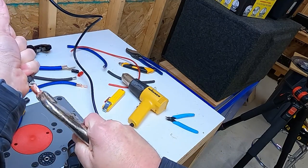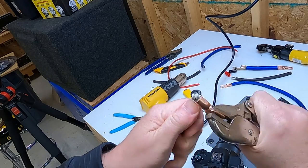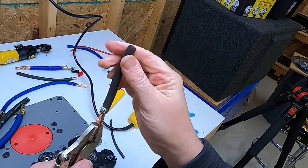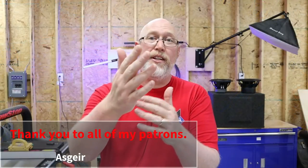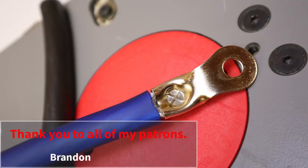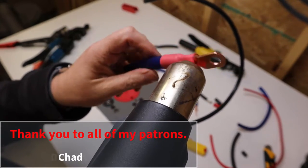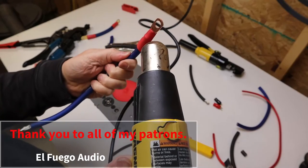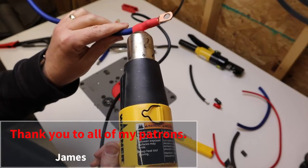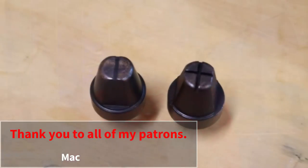Here I'm clamping on some vice grips and trying to pull the lug off of the wire. All that did was pull the wire out of the jacket itself — the crimp held just fine. I was also curious whether the positive and negative indent would be visible after putting heat shrink on the lug. Using four-to-one heat shrink, it just would not shrink down into the indent and show the plus sign. I tried it with some four gauge wire as well, and again I could not get the stamp to show through the heat shrink. So those little stamps on the indent are kind of cool, but ultimately kind of useless.